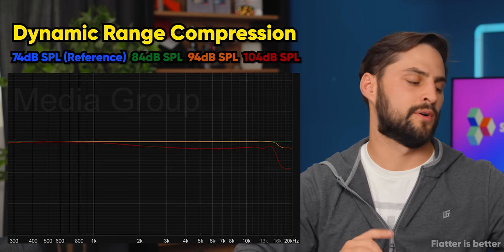The next graph is a comparison between the Bose and the AirPods for noise cancellation — lower is better. In general, AirPods have better cancellation, especially in the mid-range. But there is one spot where the Bose do a lot better — around five kilohertz — about a 10 dB difference. Both don't really do much until around 60 hertz, going from sub-bass to bass. For noise on a plane, the Bose does just as well, but the AirPods appear to do better with voices — people talking, babies crying. But both are doing pretty well.